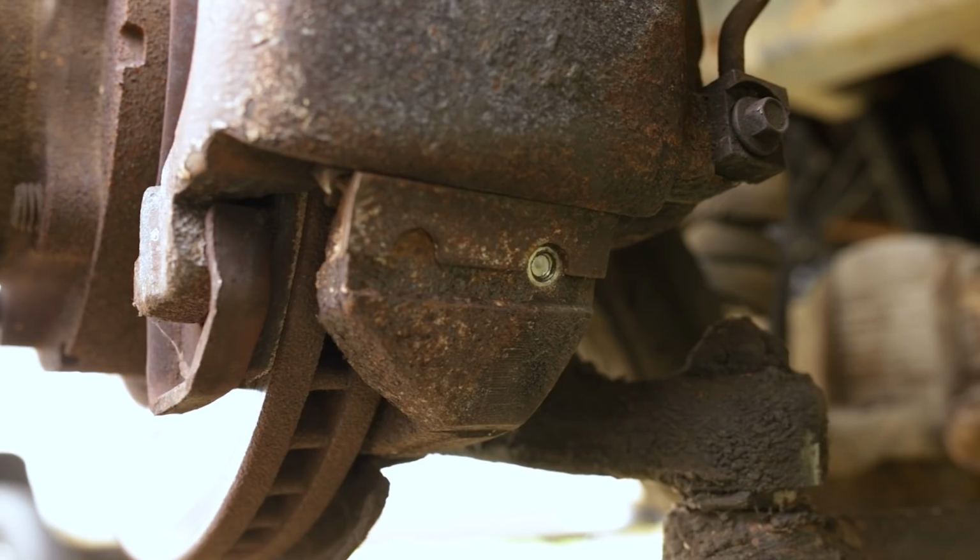They give you a torque specification, but a lot of times you'll snap them off if you actually torque them to the torque spec. You just tighten them up hand tight till you can't turn the threads anymore. Otherwise, you risk shearing them off because they're, I think, an M6x1. They're a very small bolt.